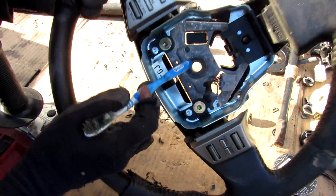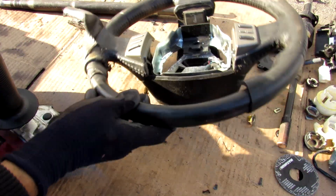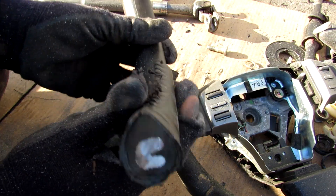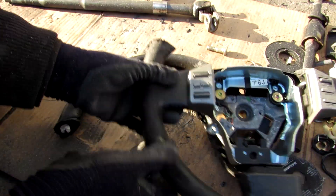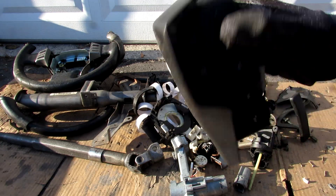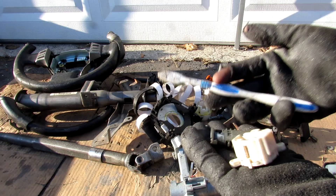The steering wheel frame is made of metal with a spline on the inside to interface with the steering shaft. The outside is wrapped in leather with a squishy soft-touch material over the frame. Cutting the steering wheel open, you can see the cross-section is actually a W shape that goes all the way around — at the bolsters the rubber part thickens up but the metal itself doesn't. That's pretty much all the components that make the steering column work in your car. Let me know in the comments what you think I should do with the airbags — blow them up or make a science experiment. Make sure you follow on Instagram for behind the scenes footage and subscribe for more videos like this one.